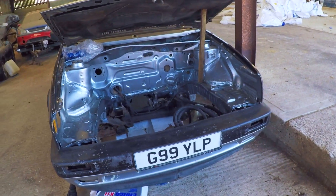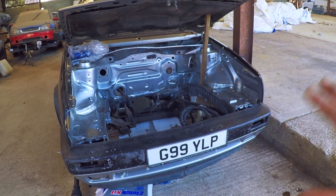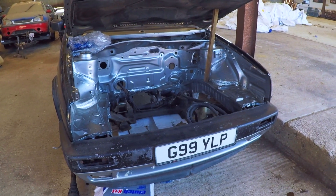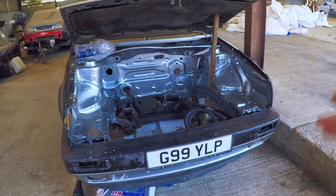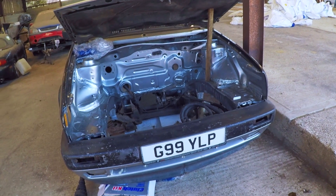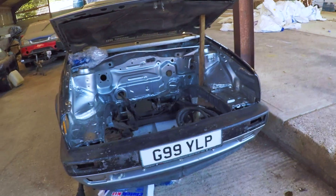The gearbox is a really nice unit — it's a six-speed but it's a smaller O2S six-speed box, set up as a hybrid with an O2J bellhousing for the speedo drive. We've put a nice close-ratio gear set in it so all the gears are short and close, and then sixth is just slightly taller than the original fifth would have been, giving you a good balance of acceleration and cruising. The gearbox also has a Quaife differential, which is perfect for this car.